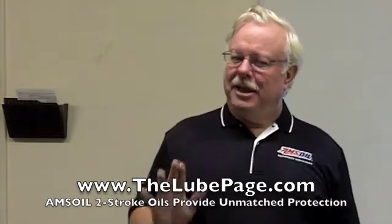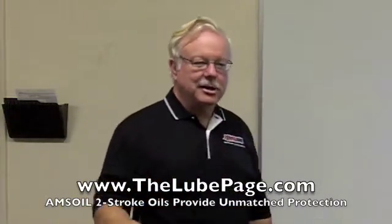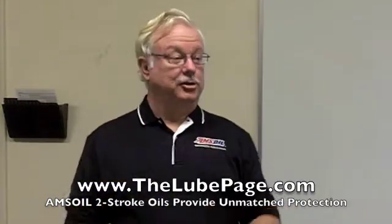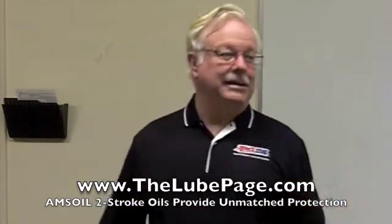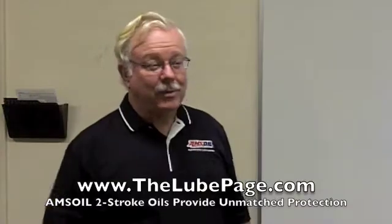So the old days, what they did is they took like a 40 weight oil and they mixed it at 16:1. So really what you had was a gas oil mixture, literally 16:1 mix. That would be an ounce of oil in every pint of gasoline, okay? So it was pretty thickly mixed, and that wasn't the end of it.